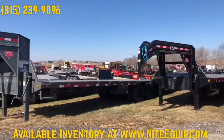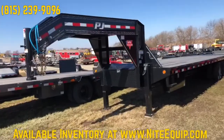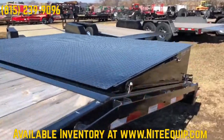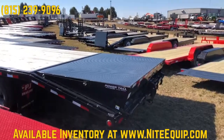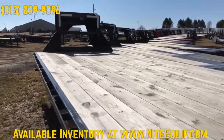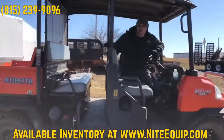There's another function on this one — this particular trailer has the hydraulic beaver tail. It's the new power tail from PJ. We do have this demonstrated on our YouTube page broken down into four short videos. The power tail is a big single sweeping beaver tail over the back of the trailer — like the monster ramps but a one-piece deal, no lifting. You can run it up or flip it all the way down and haul back there. On the LY models with a 10-foot hydraulic beaver tail, you're not supposed to haul on the last six feet. But with the power tail or monster ramps, you get a five-foot beaver tail and you can haul all the way to the tail.